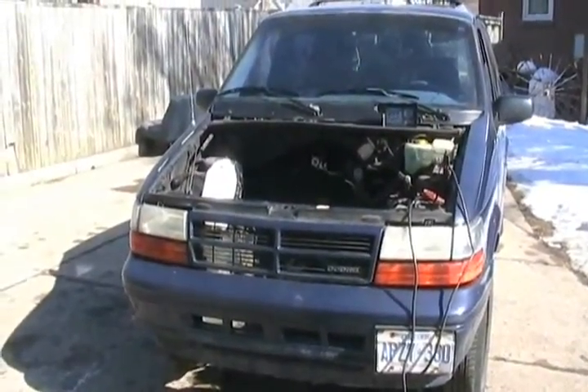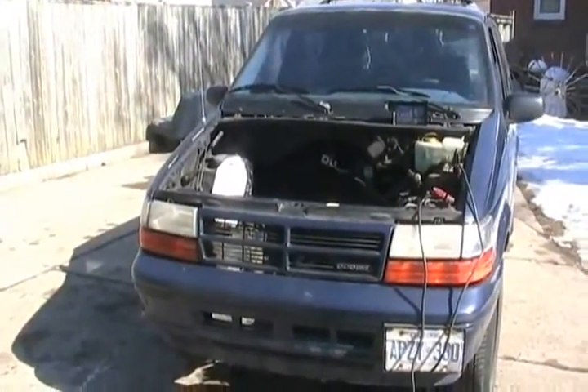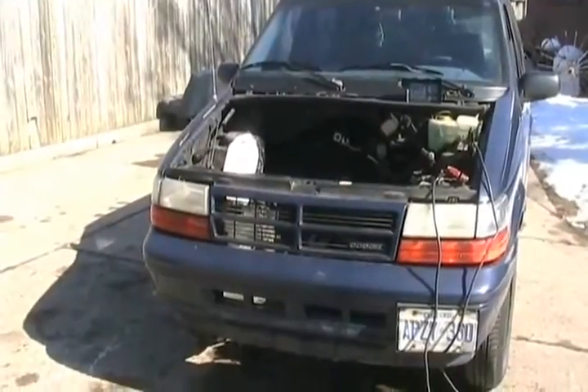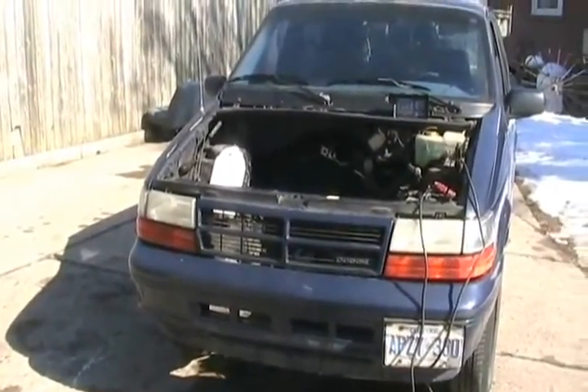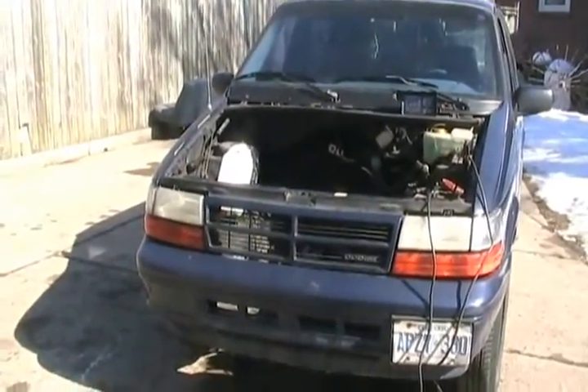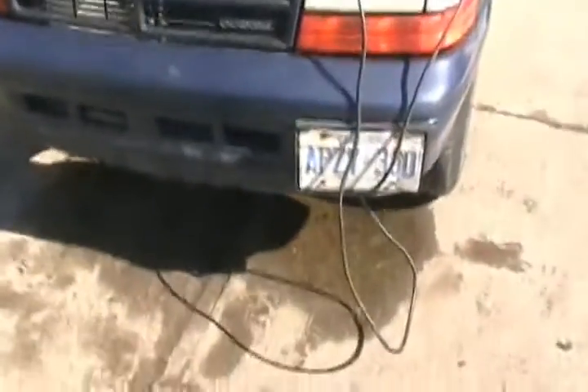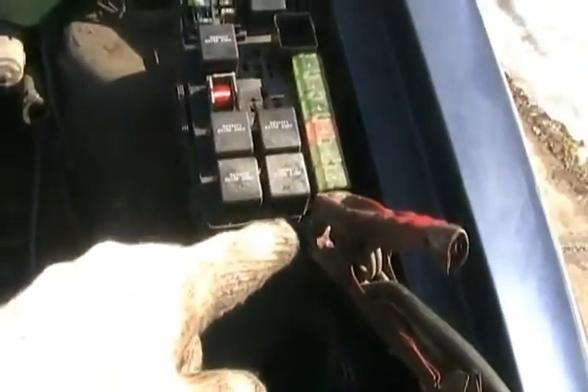Since this is a gas engine plumbed vehicle, I have to first purge the fuel lines of the gasoline in them to get diesel coming through — so I don't get gasoline into my diesel injector pump. Since I have all the battery wires removed, I've got the battery thrown in with a positive cable running to the B-plus bus on the fuse box.